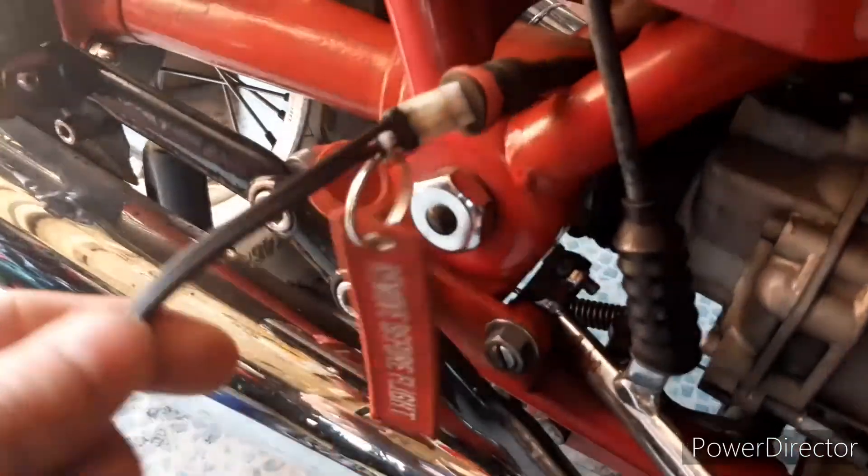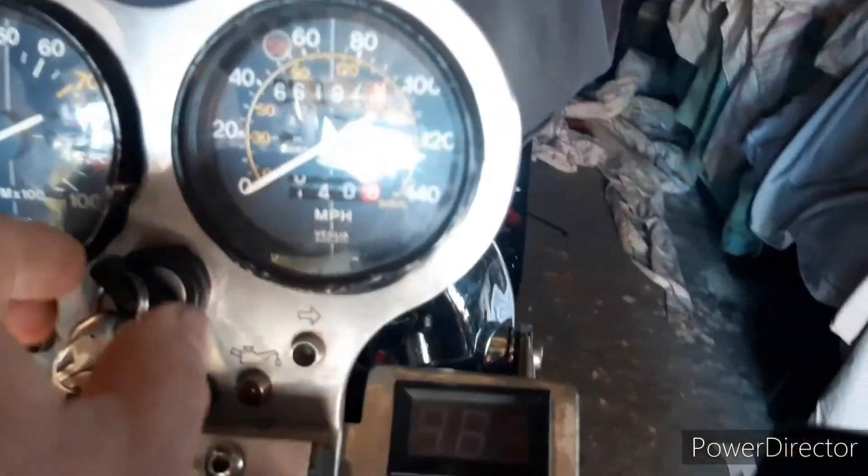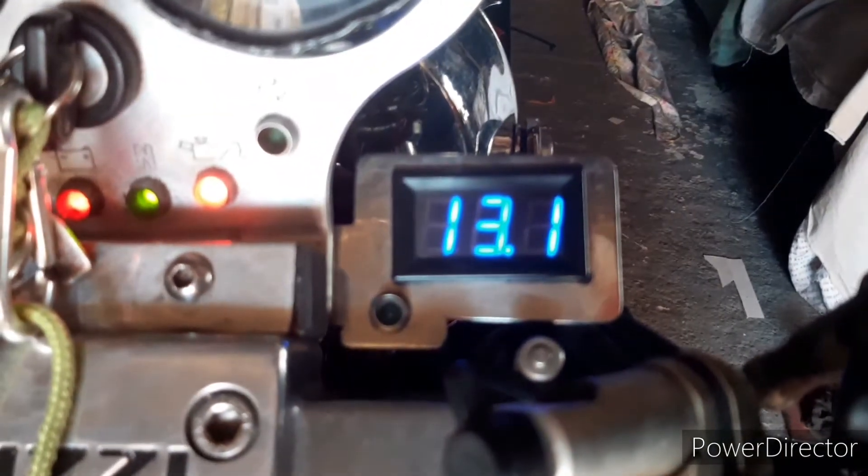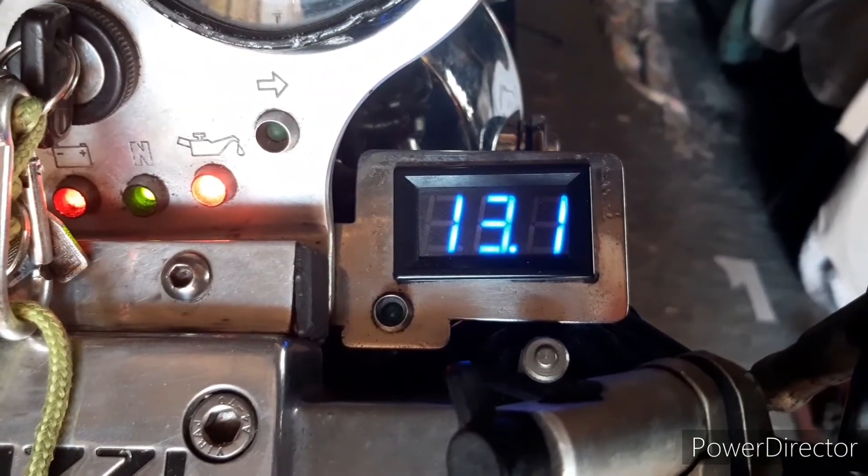On this I've just connected the battery charger. I'm going to check to make sure that my battery charger is working. I'm expecting to see quite a high voltage on here — I'm seeing 13 volts. So that's definitely charging the battery.